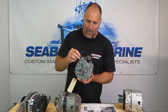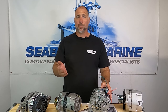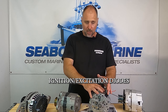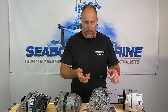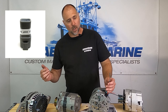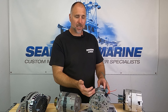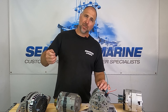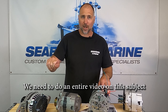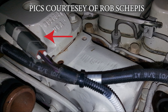If you get a brand new alternator it may not work right out of the box — you may need to touch the field wire just once to battery voltage, then start the engine and it'll work. If an alternator is losing its residual magnetism or you have to rev the engine very high to get it producing electricity, you may need to connect the excitation wire through a diode. When you turn the key on, electricity excites the field through the diode; the diode prevents back-feeding onto the ignition circuit when the key is off. If your engine won't turn off after replacing an alternator, that excitation wire likely needs a diode — we sell the diodes and diode pigtail sockets.